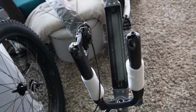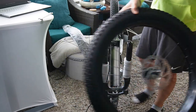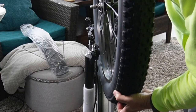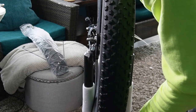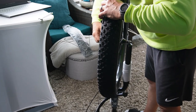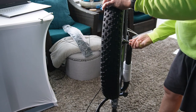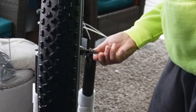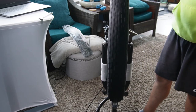You can see I actually didn't do it enough when I dropped it in here. You're going to see the front disc brake caliper, and you're going to need to put that disc in there — it can only go in one way. You see the disc caliper there, and then you have the disc itself. So you have to drop the tire, and this is why it's easier if it's upside down because gravity can help you. You're going to kind of slide it right into that caliper. It only goes in one way. Once you kind of wedge it in there a little bit, it shouldn't be too tight. I had to loosen it a little bit more just to let gravity do its job and let that wheel fall right into that. There it is, right in there.